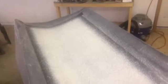All right, to Jeff Lindsay out in the garage. Saturday the 15th. And we've got the door skin prepped and went ahead and sprayed U-Pol Raptor liner on the inside. Maybe that stuff's good enough. I think it'll be fine. We sprayed a thick, heavy coat, textured. And of course we haven't taken off the tape or plastic yet. But that's what we ended up with. We're going to set this thing outside because it is giving off some terrible bad fumes.